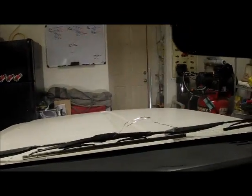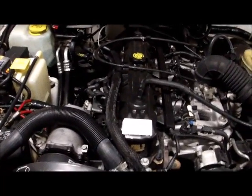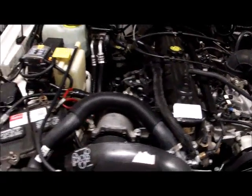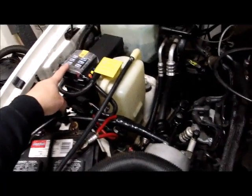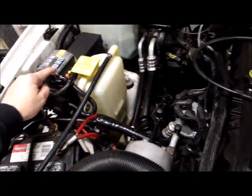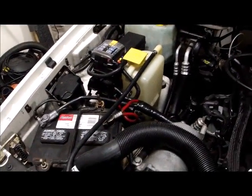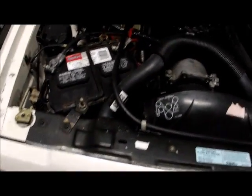I also replaced the LED bulbs behind the rear defroster and AC panel — the factory ones were really dim and I couldn't see them at night, but now they're easy to see. I changed the LED bulbs for the dome lights and also changed out the headlights to LED in the front. Under the hood, the engine was steam cleaned or pressure-washed before I got it — that's why it looks so clean. I added an extra fuse box that runs three fuses just for the alarm, one for the ARB compressor, one for the radio amp, and one for the accessory power distribution block inside.